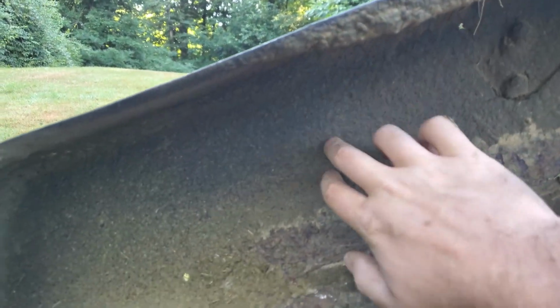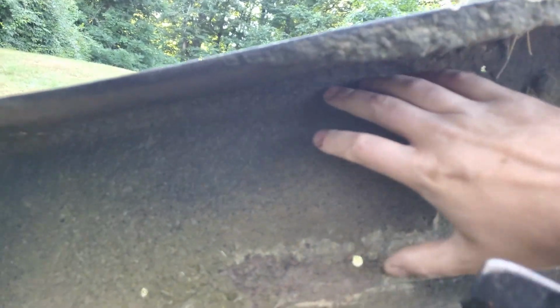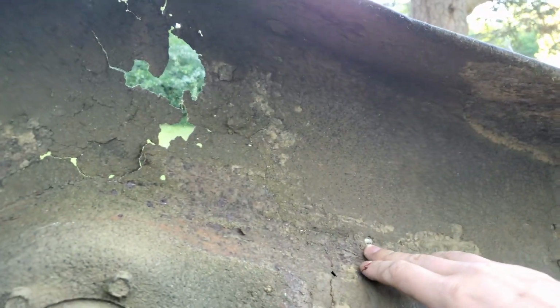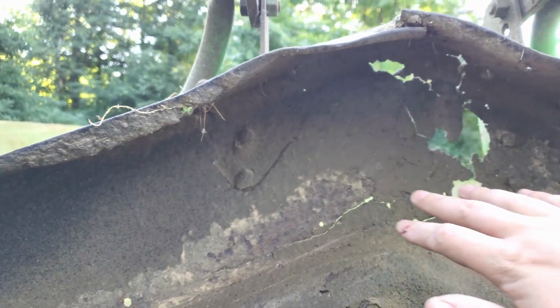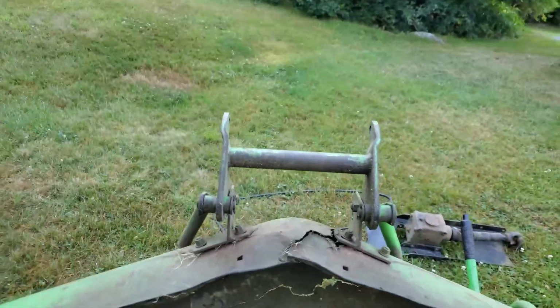But I think it's pretty solid over here. I might basically go from that hole, get a plate to come up to here, and then over to that plate. I'll weld it along here, and then I will bolt. Here's the 2 bolts for that bracket and 2 bolts for that bracket. Bolt those right through, and I think I'll weld along this right here to try to keep everything in line.